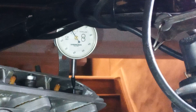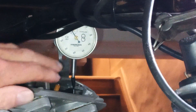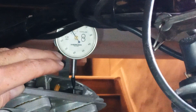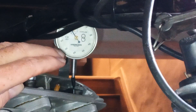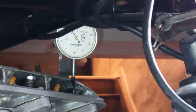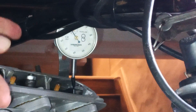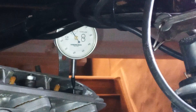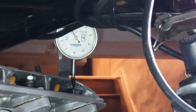I've set the camera up as best I can so you can see the dial gauge — that's about the best angle I can get. I'm going to turn the engine backwards now. We're looking for the gauge to go around to 150 thou, as near to 50 as we can. As that happens the inlet valve is going to close, and when it's fully closed it will stop moving — that's the reading we're looking for. Turning backwards now.